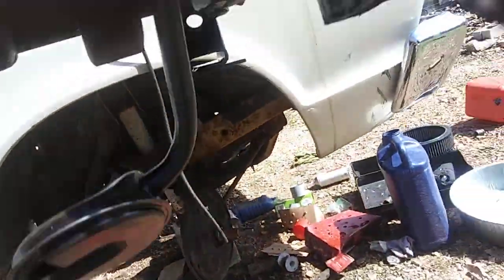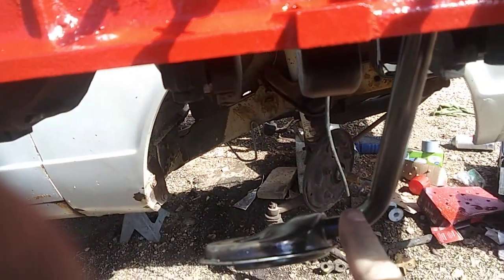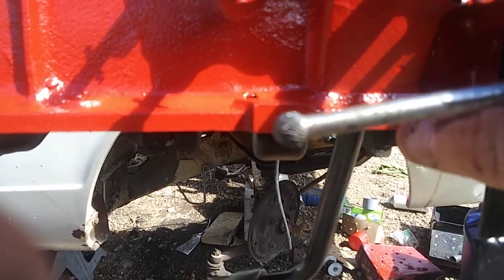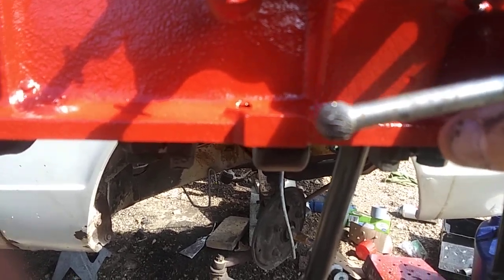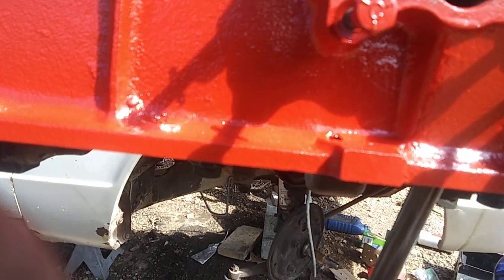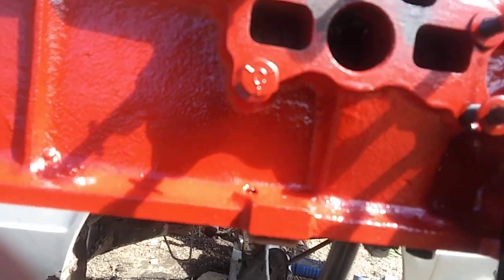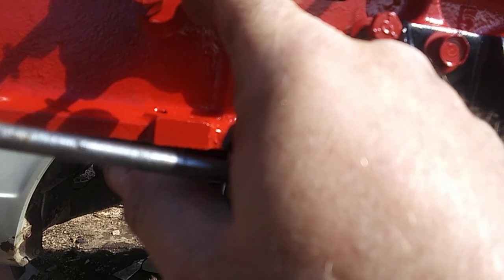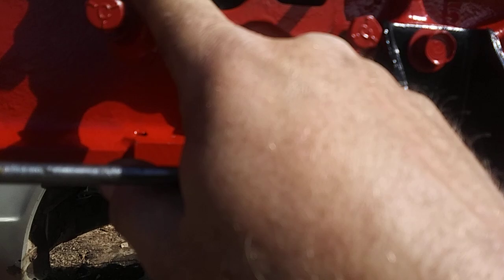So here's what I'm talking about — this port here is where the oil pickup tube comes up through the block. There's a sharp edge, a circular lip all the way around, and we're gonna be smoothing that out. I'm gonna take the pickup tube off anyway since it needs to be cleaned out. Up top here there's a port that's plugged off — I don't even know why they made that; they should have just kept it solid instead of having that hole.